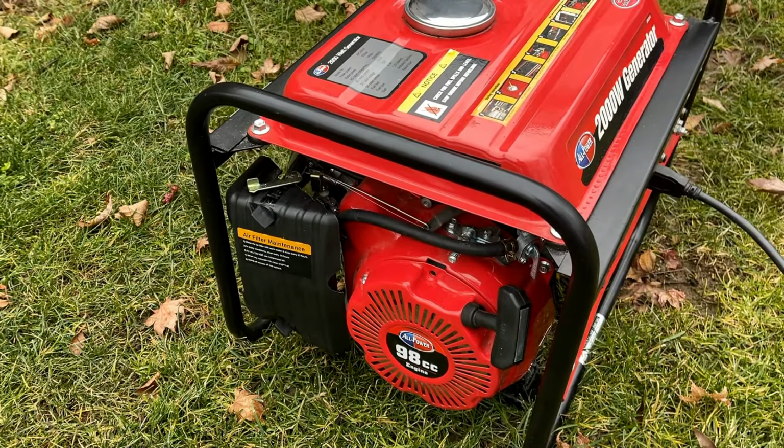I obviously took it apart again. Nothing too obvious, but this pilot jet, when going through it with the micro drill bits, it did feel like there was a decent amount of plaque buildup kind of along the walls. So I've scraped all that off. That is definitely cleaner at this point. Next, I'm going to try to free up this jet here. I'm just going to get the Dremel out, try cutting a slot there, something that I can get a screwdriver on, and potentially use that to break that free.